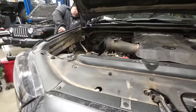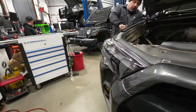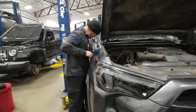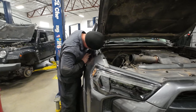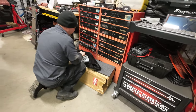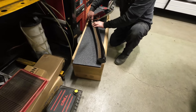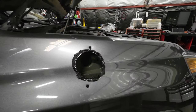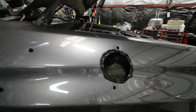All these holes — he's going to use a deburring tool to get all the sharp edges off. He's going to do a final test fit just to make sure everything was done correctly, and you can see that he really takes his time. The final surface prep is done before the double-sided tape goes on the back of the snorkel. He also did a little RTV around each of the holes for additional sealant. And when he cut those holes, he did paint up the raw metal to prevent any kind of future rusting.